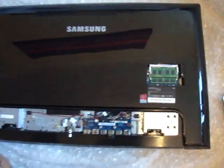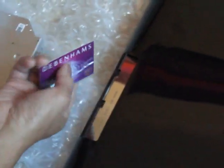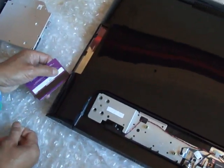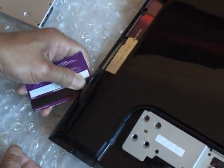I've also taken the memory cover off. This screw is removed, which allows you to remove the Blu-ray drive. That reveals a further two screws here, which must be removed without breaking it. So I started by getting a credit card, jamming it in the side here and just wedging it in.